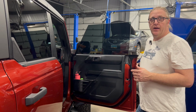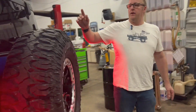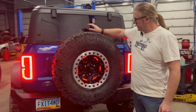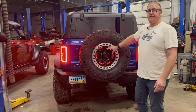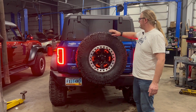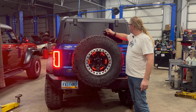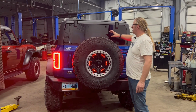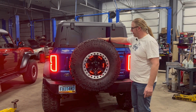So the last mod that we've got, if you follow me around back, it's the third brake light. So we removed the factory third brake light and went to a third brake light inside the wheel. I like the looks of this, but more importantly, the factory third brake light takes a lot of space, and there's not a lot of room to view out the back of your vehicle. So this blocks a lot of your rear view. By taking this off, we get better visibility looking out the back of our vehicle.